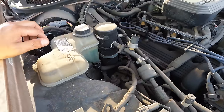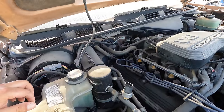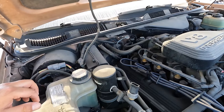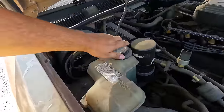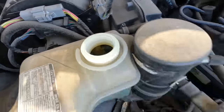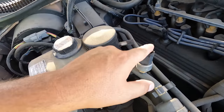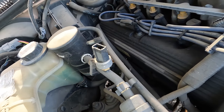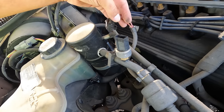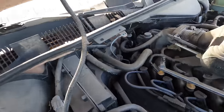I would almost be willing to bet we've got either a starter relay issue or a wiring issue going to the starter solenoid — that little wire that tells it to start cranking. I'd almost put money on it. I'd almost bet I could have this thing running in a day. She's full of coolant — that's good. I'm curious where the wiring is for the air conditioning... there it is, right there. Someone just disconnected it — no rats nest, no major wiring issues.